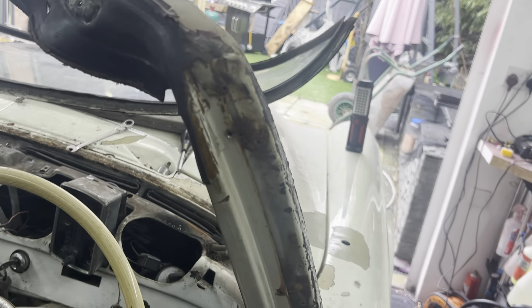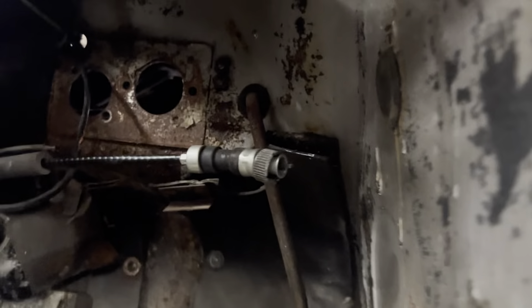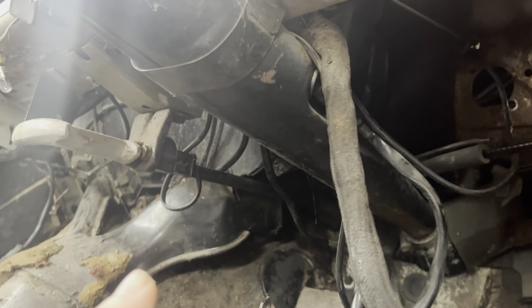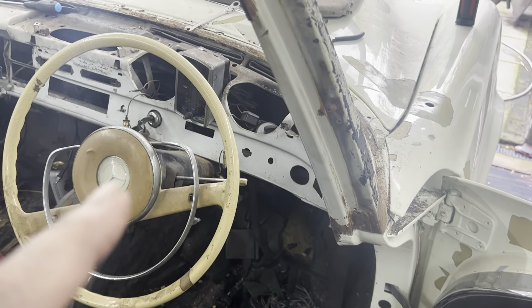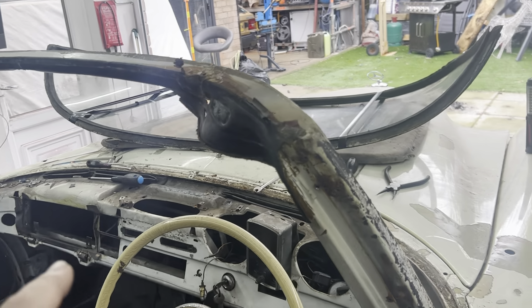Obviously I need to strip all this out - that's where the hole is, so I'm going to have to do that botch there. I'm going to leave that because it can't be seen and I don't want to go too far. When I clean this off I'm going to weld up every single hole going round and re-screw all of them. This leather obviously needs to come out, the whole dash is clear. I can see bits of surface rust. I'm going to take a paper template of the master cylinder holes and find some universal ones to suit. The heater matrix seems to have a drip but it seems to have stopped now, and I'm going to take all this plastic out and take out these vents today. I've started working on the lights - most of the lights are working at the front, but the passenger side indicator's not, so I need to do a bit on that.